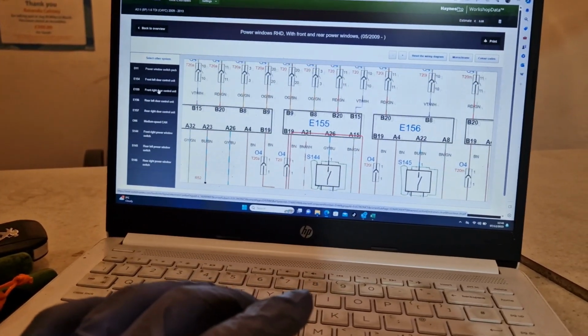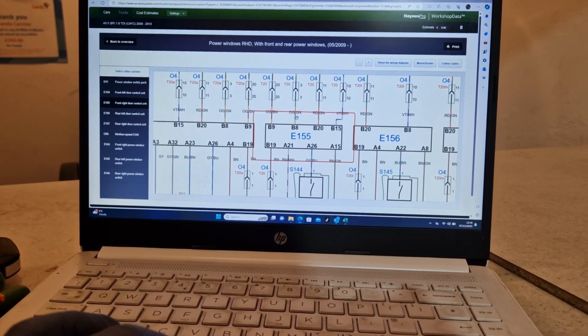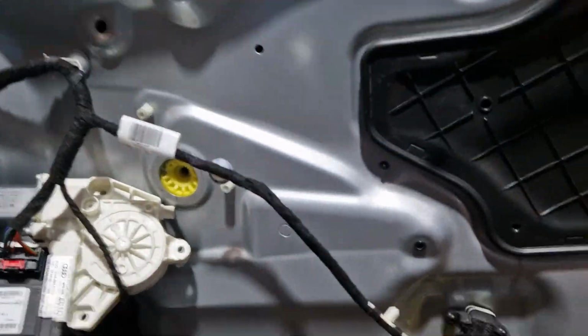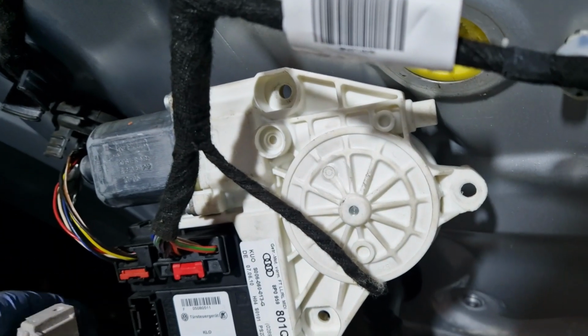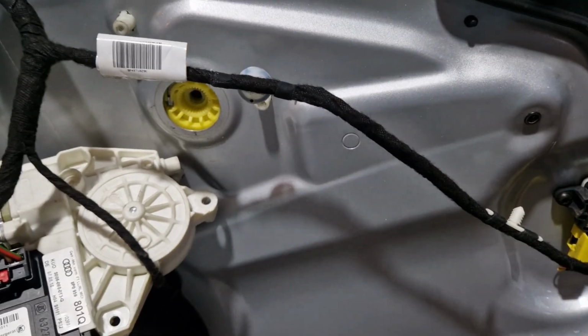Front right door control unit is there, and it's these two here, red and green, orange and green. Take you out and show you. Red and green, yellow and green. Got our test lamp there. We've taken the thing away, I need to plug it back in. Squeeze. So I'll plug her back in, and then I can operate the switch.